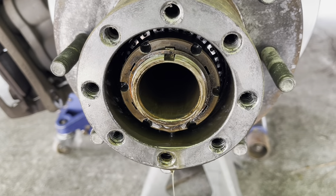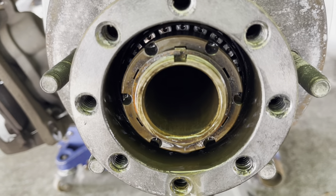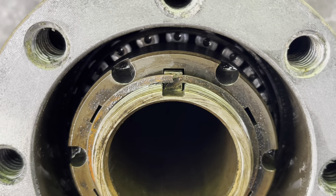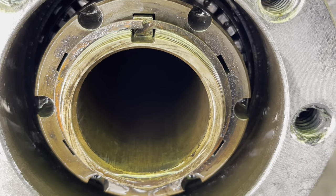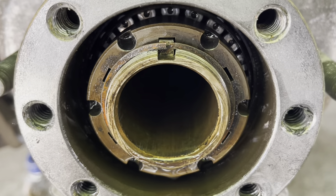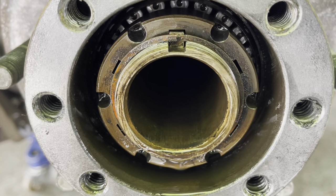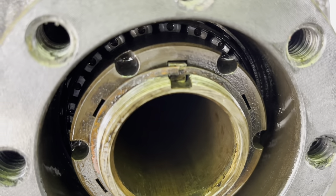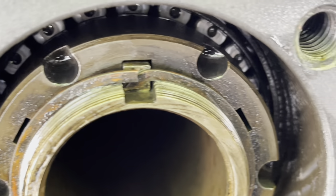Once you slide the axle out you will see the locking ring, locking spring, and locking block, along with the outside tapered roller bearing. You can already see wear on the shoulder, carbon and grime buildup — it was not clean when the mechanic put it back together. You need a special tool to do this; if you don't have it, stop and take it to a qualified person. You can see they beat on it with a chisel to get it tight — the edges are knurled up.